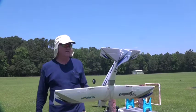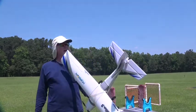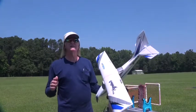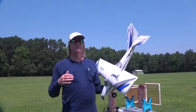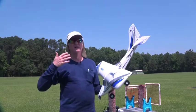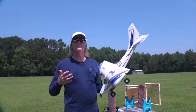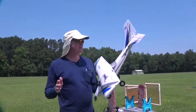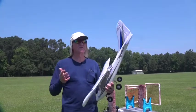Welcome back. In this video I'm going to explain an elevator change that I made. After flying around a while off camera, I noticed it was actually flying slower than I wanted. It would fly at level flight with 30 percent power — that's too slow. In fact it was only maybe five or ten knots above the stall speed, and if you pushed the throttle up to 50 percent it would always climb.